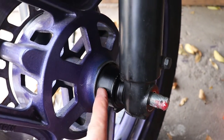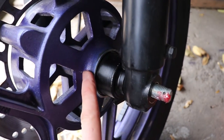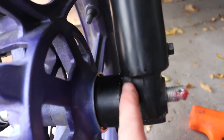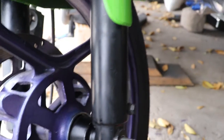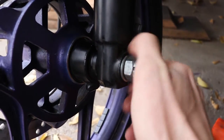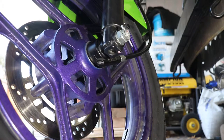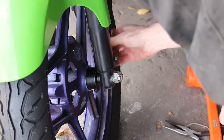You want to make sure the hub is fully seated with no gap. There are two little tabs on the wheel that you need to line up, and there's a little tab on the axle that meets up between two tabs sticking out of the fork, limiting its rotation range. Put the washer and castle nut on — this gets tightened to 65 foot-pounds. The 1/8 inch by 1-1/4 inch cotter pin worked well here. Don't forget to reinstall your speedo cable.